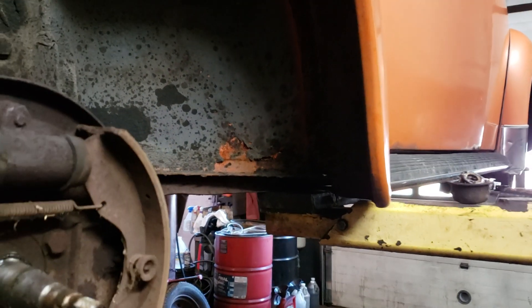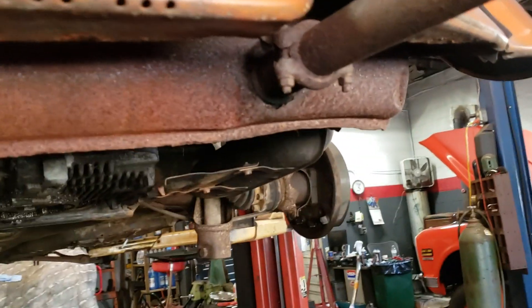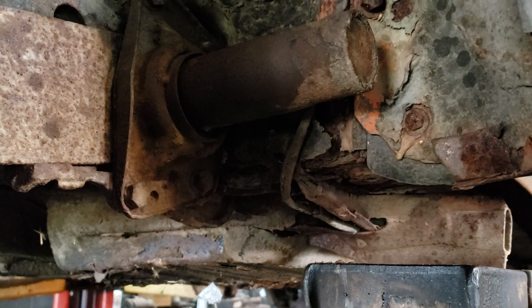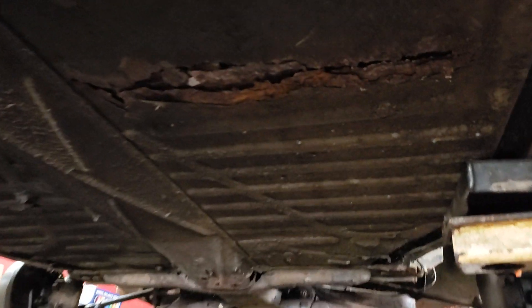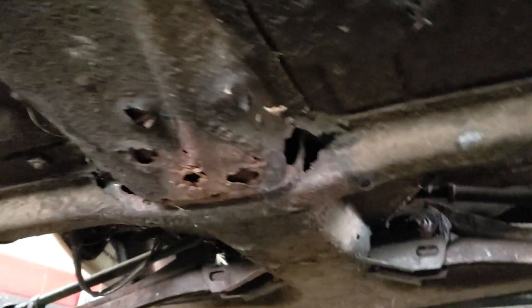The big question is the rust — shocking conclusion: it has rust, which I don't know how much is acceptable for one of these. But it's Pennsylvania, so you can only be so picky with a classic car because they're all kind of rusty junk. Back here has a hole in the muffler, which is whatever. It's leaking oil, which I think is just a natural state of these things. There's some rust here in this wheel well behind the torsion bar. The battery box under it is rusty, which the old owner warned me about — he said this was the worst rust in the car, and I'd say he's pretty accurate. Up here we've got some more rust; that's the other bad rust in the car. The rest of the pans aren't like terrible. Someone got wild here and did some airborne stunts — some more rot there, some more there, and some more up here.